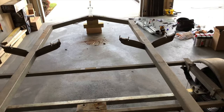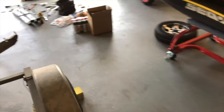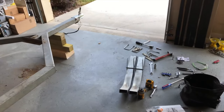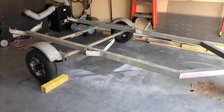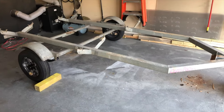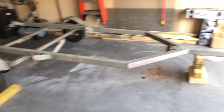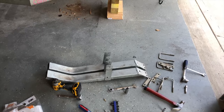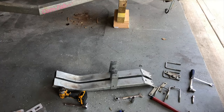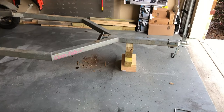When I took it out to Confab, Lawrence and the team hooked me up with a 2500-pound axle. You can see right in the middle where they made the splice point and ran a steel beam in between then welded it back. The reason they had to do that is to actually shorten it — make it a little more narrow — because those 2500-pound axles are designed for wider trailers that wouldn't fit in my garage. They trimmed some width off so it fits the way the trailer was originally designed. So now I've got a really nice galvanized trailer that's about to be bright cherry red with nice wheels, tires, black bunks, and all new hardware.